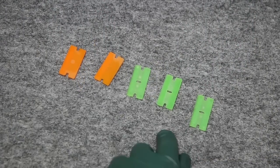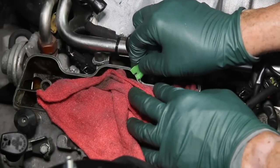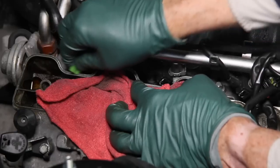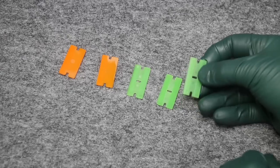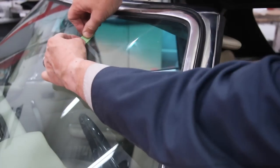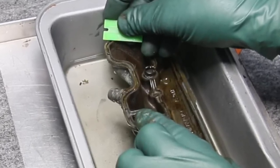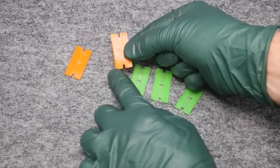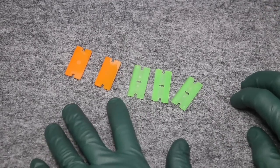Right here folks, these are my favorite tools this week. I just completed a rather tedious repair of a leaking breather cover in an M113 engine, and these plastic razor blades really came in handy. Some of these now have some really nice sharp edges and can fit in a razor blade holder so you can actually use it as a scraper. They don't last very long but they are really good in certain applications — particularly for cleaning pitch and other contaminants off automotive glass. They also work for getting into critical areas on sealing surfaces on magnesium and aluminum engine parts. This style with a blunt edge and rounded corners lets you work into areas you really want to protect from scratching. Plastic razor blades should be in every toolbox.